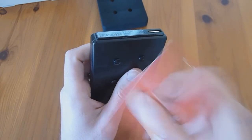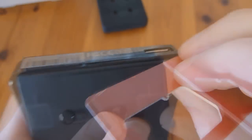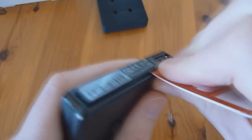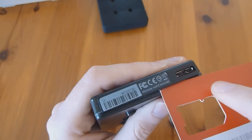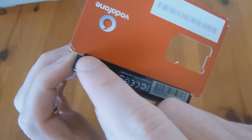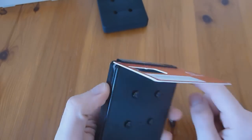The first step is to get a credit card and slide it into this little seam here. When doing this, it shouldn't touch the rubber seal because it sits underneath this little plastic bit. Just stick it in at first — you can kind of hear it pop in. Then get the entire credit card along the entire seam. From there, bend the card this way so it starts to peel off the top.